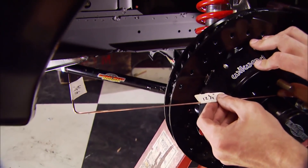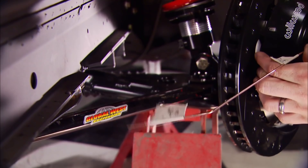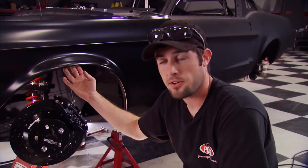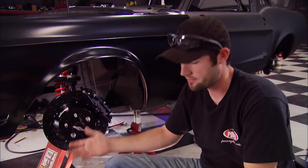Now with it held in place, turn the wheel to the far right lock. This will show you how much clearance you have from the inside of the tire to the outside of the frame rail. To check the clearance to the outside of the fender, just reverse your measurement from the mounting flange to the outside of the wheel. There you go — you've been edumacated.